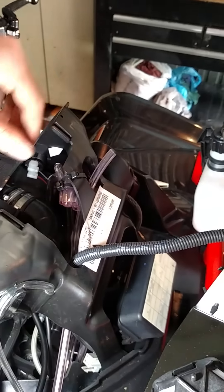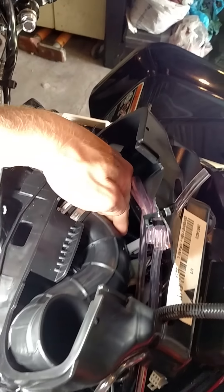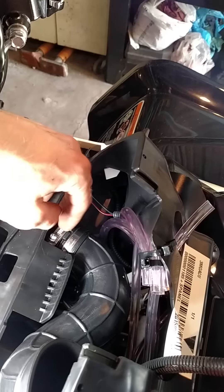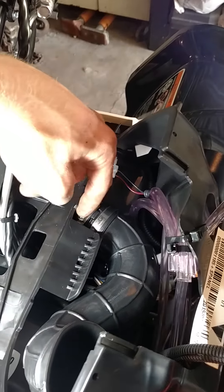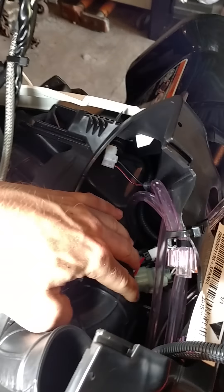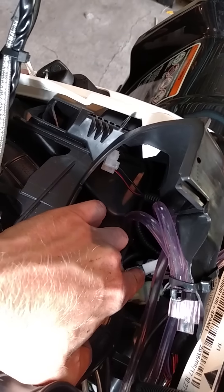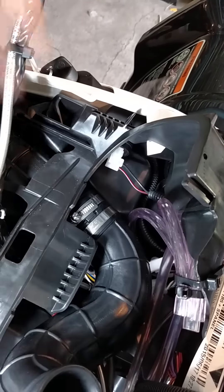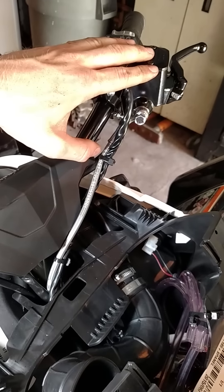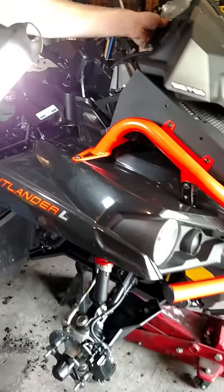That solenoid is not powered until you actually hook another wire to it. There's a wire back here under the snorkel. You might not have this if you have a base model, but if you have an XMR you will. You want to undo this one bolt that holds the hose on — it's actually going to be hidden up under this little flap. You take this out of the way, and there's a white connector right there that's going to be holding a black connector going into it. You unplug that and you plug this in line with it. It already comes hooked up on the switch, so you won't have to do anything. What it prevents is — you can't activate the winch while the vehicle is just sitting, which I like. It's very nice.